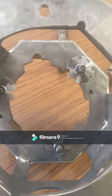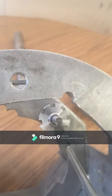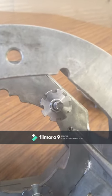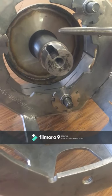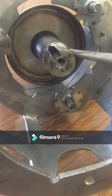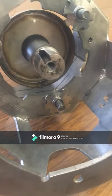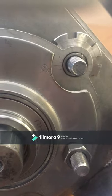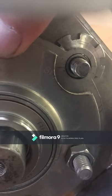Here we show the three adjustment nuts in position. Note that with some ovens there will be two roll pins on either side — these are now redundant and no longer used. By simply using a hammer and a drift or a socket extension the pins may be driven up and out of the way. Before putting the bearing unit in, check that the taper has been put in position, the mushroom flinger plate is in with the flange end facing down, and the taper is pushed up firm. The bearing unit goes in with the taper facing up, directly onto the shaft.